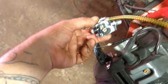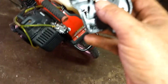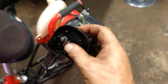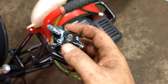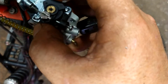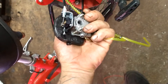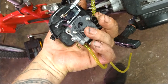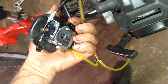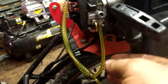Now we're going to mount the carburetor and take the air filter assembly — the flat side goes down. Let's hook up this throttle cable first: get it pulled over, laid in there, and it clicks right into place. Now take the air filter assembly, flat side down, and stab it into the carburetor. Put the gasket on with the little holes towards the primer ball, then mount it to the engine.